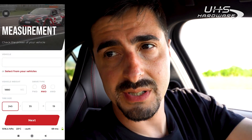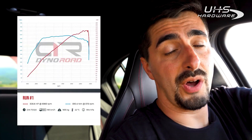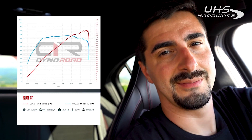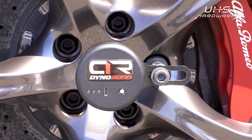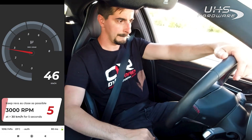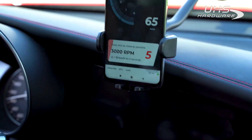Before proceeding to the actual test you must do the initial calibration. You have to use the same gear you're going to use later. This is a real-life test, so the weights you're logging have to be accurate. The dimensions of the wheel and the type of gearbox are very important to get it right. For higher accuracy I suggest doing it on a higher gear — 4th gear should be fine, but for now I'll do it in 3rd. Everything depends on the strip of road you have available. This is the graph of the car when it used to be stock. Now she's tuned with Stage 1, so let's start the testing. Let's bring the engine up in 3rd gear, up to 3000 RPM to calibrate — for 5 seconds.